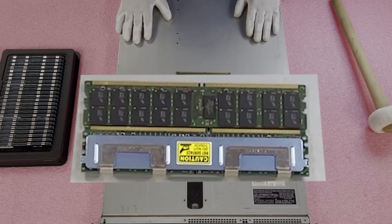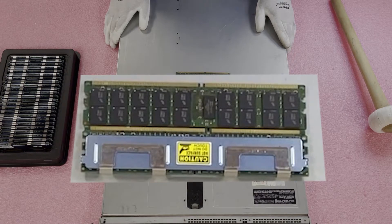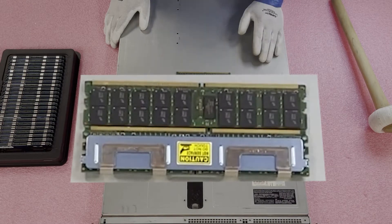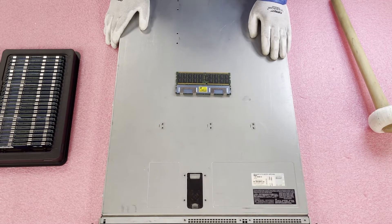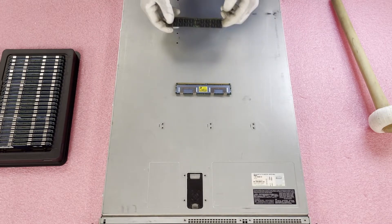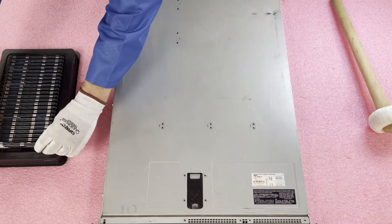You're just going to run into an error that you don't want. The manufacturers put this key here to prevent people from putting in the wrong RAM — it's an all too common problem. Also, more often than not, ECC registered does not have a heat shield. Fully buffered nine times out of ten always comes with a heat shield. The registered ones rarely have a heat shield. I wanted to show you that — it might be a little helpful before we get started.